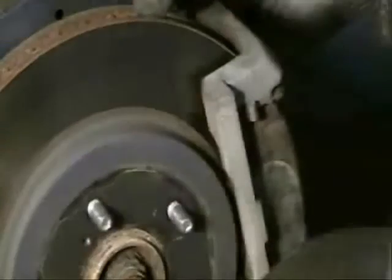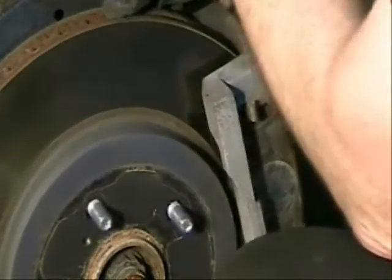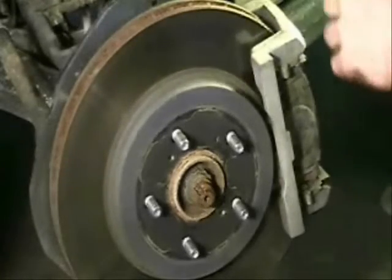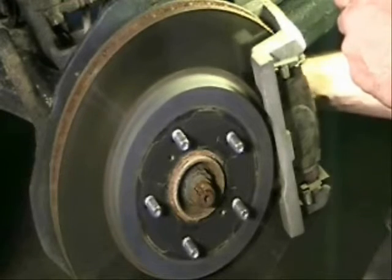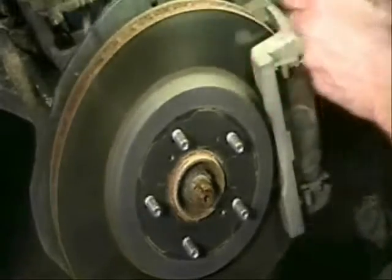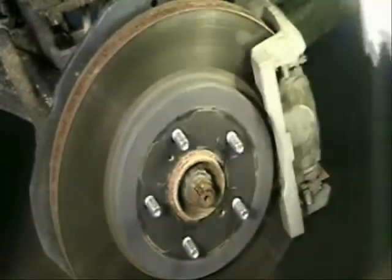I like to use a bungee cord — you never want to hang the heavy caliper by the hose and possibly have the hose break on you. Hang the caliper well out of the way. This is also a good time to check your suspension, see if you've got any evidence of the shocks leaking. I actually see the CV joint here; the CV boot has a little tear in it, so I may tell the owner about that. I've actually got a video on replacing those. So it's a good time to check for all that stuff.